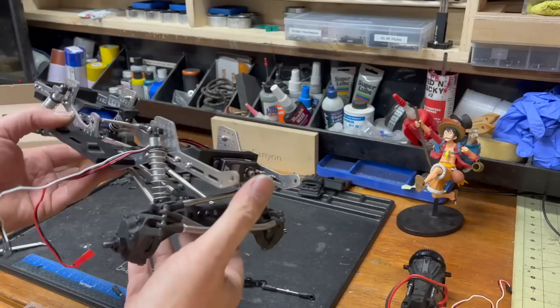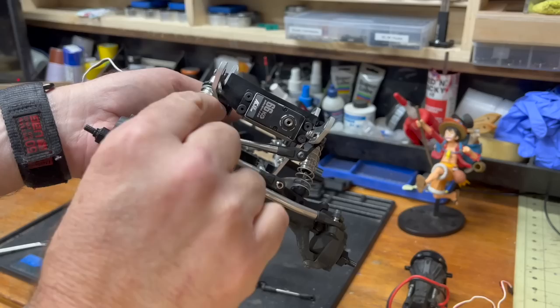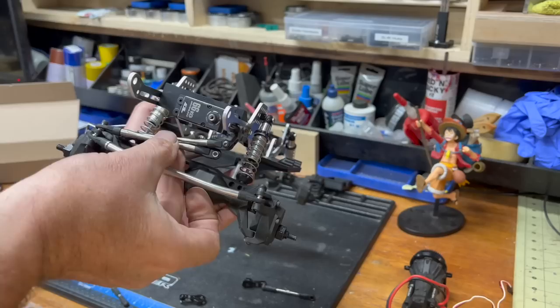Much to my chagrin, I have had to resort to the bins at the current phase that I'm in, because this is what I would call a launch edition Phoenix. So the new panhard and steering links that come on Phoenix now are just straight. They don't have the little shoulder on there, right? Which gives you some adjustment range. My panhard, as you can see, is too long. It's pushing it way over to the side. And the steering drag link is way too long.